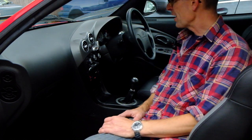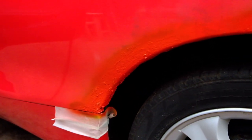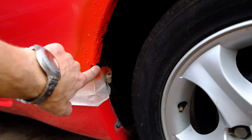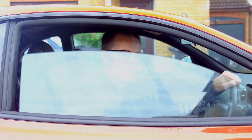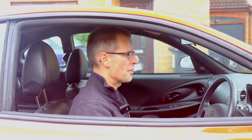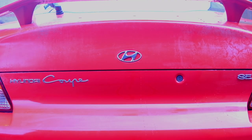I've now got an hour and a half to the MOT test and I think everything's working. This is what is known as an invisible repair for blind people — it's had rust killer, zinc rust-proofing spray, a bit of primer, and then the can of red that I found in the garage which is close enough. It's shiny, there are no sharp edges, it's been serviced. The only concerns are if the wipers play up during the test — though I can tap it and show it's working for an advisory — or the emissions, which I've got no control over. But fingers crossed everything's good. Let's go.